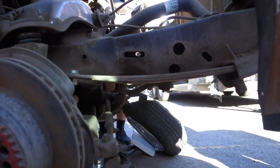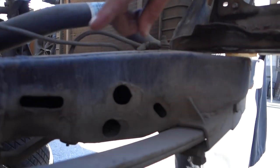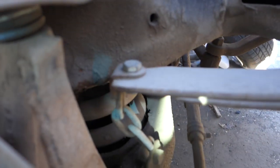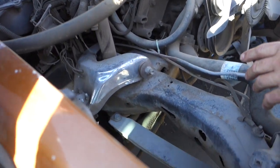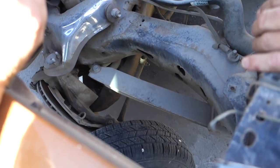That's probably what I'll do too. If you look at how far that spring pocket pockets out for a G-body arm — I did two things with this car: I moved the spring pocket out, and I brought the ball joint in three-quarters of an inch.